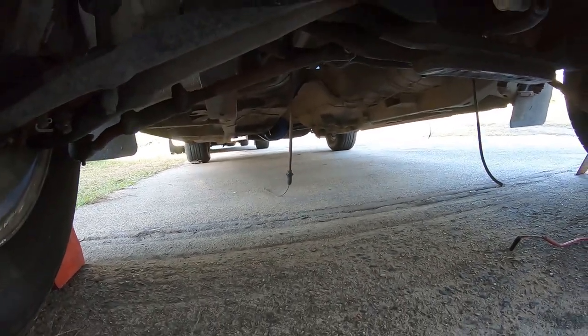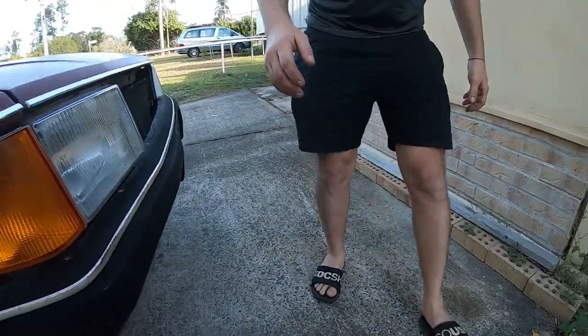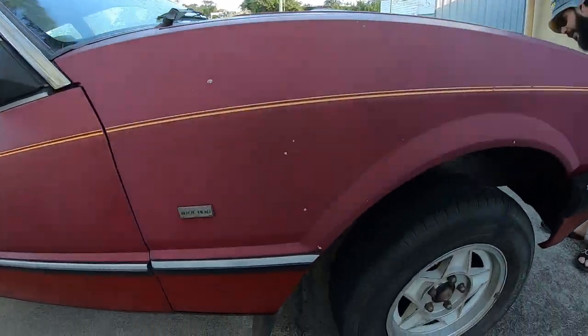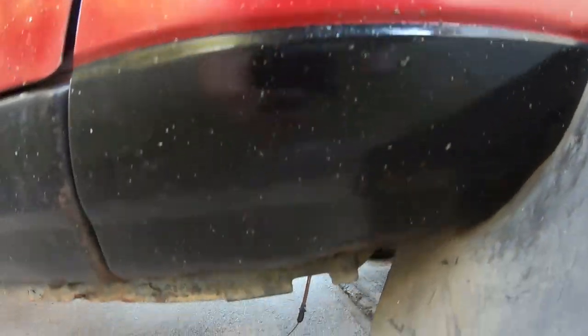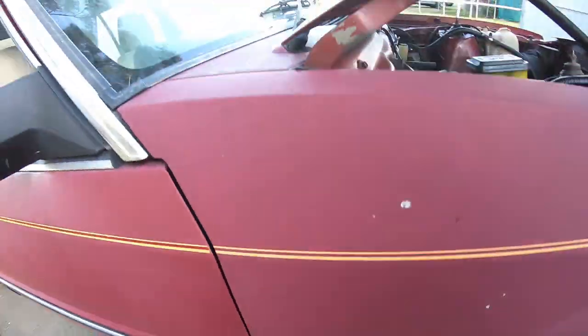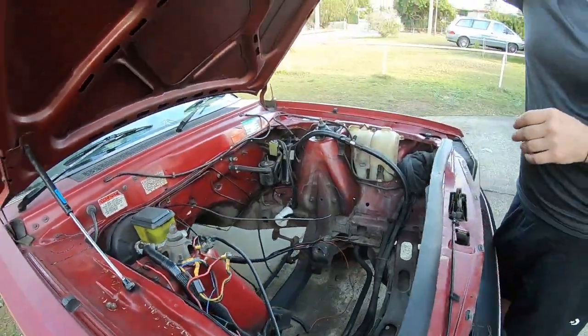That's basically a full lower inspection. Moving up through the car — you've done the seals, checked the doors. You can get the bonnet open; it's not hard to check out the guards. Look at the guard, peek in through the door. There's a lot of telltale signs in the engine bay and bonnet. Straight away you're checking the bonnet lip, right down underneath, looking the whole way across.